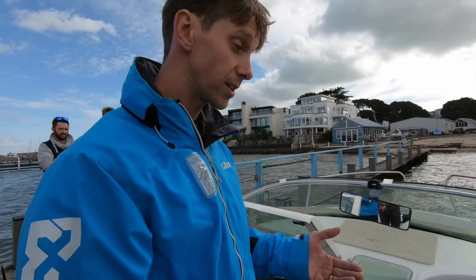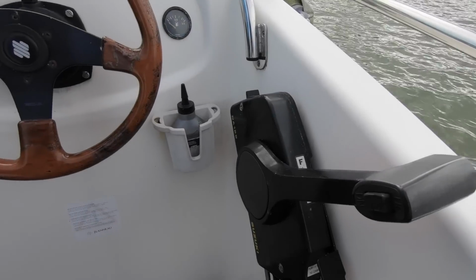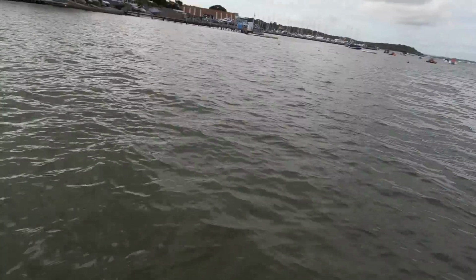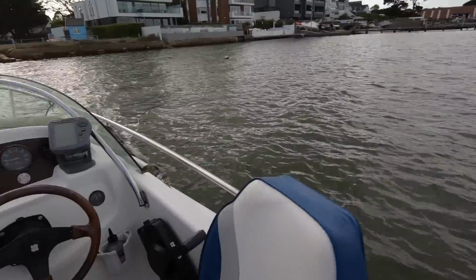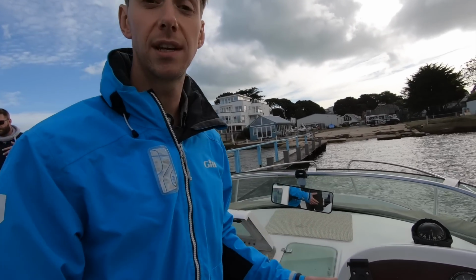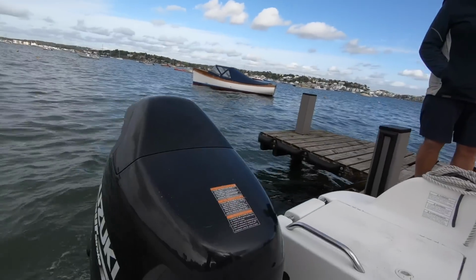First thing you'd want to do really, if you're coming onto the boat and you've just installed it, is just a check. So ignition on. Okay, engine's running. So you've got your engine running. Without getting wet, the easiest check is to switch the tag off, because that's essentially the same as breaking the connection when you go in the water, either through distance or through submerging it. So to switch it off, press and hold the switch for 5 seconds.